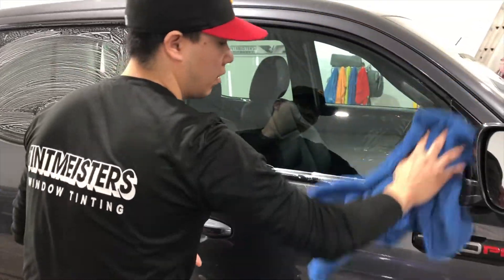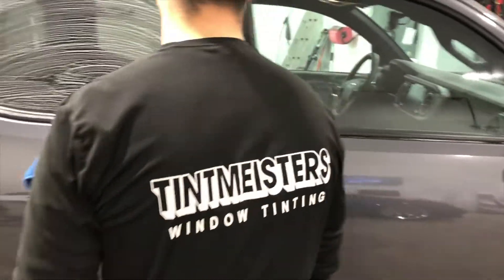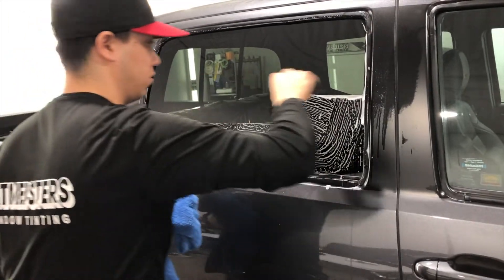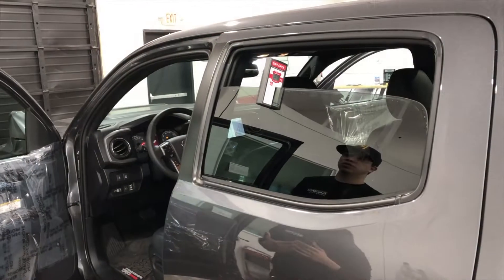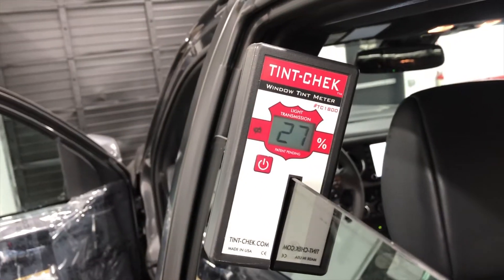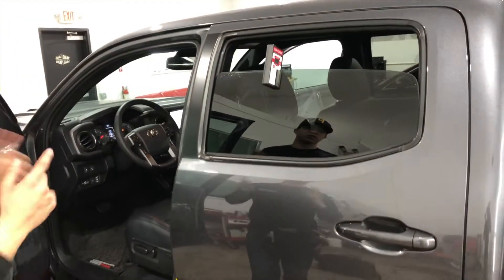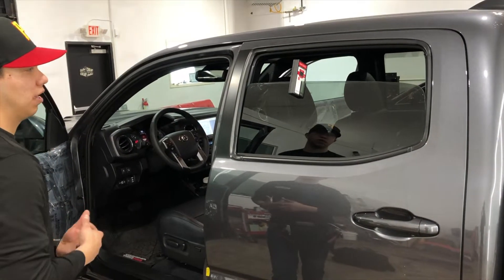It's a bit of a harder side to shrink, not quite as flexible. So you do have to compensate on the angles on how to feed the lower portion of the film in so you don't get creasing. There's definitely a lot more to it in terms of matching compared to any other films, just because it doesn't turn green, brown, or light purple — it's very, very close. And going with XR Black is going to give it that much more of a richer, great-looking color.